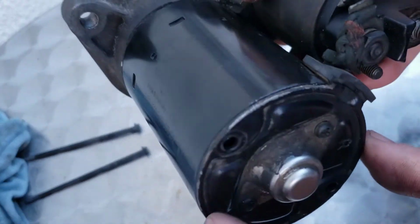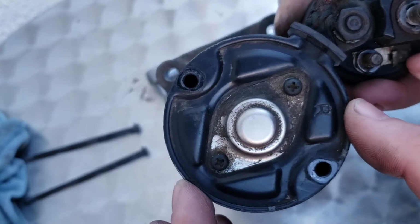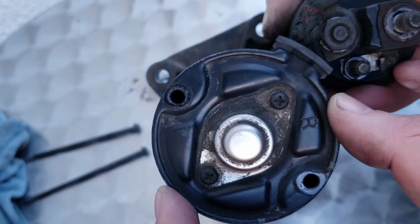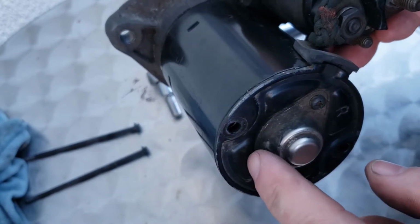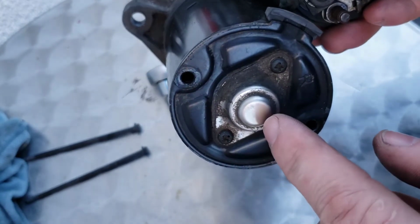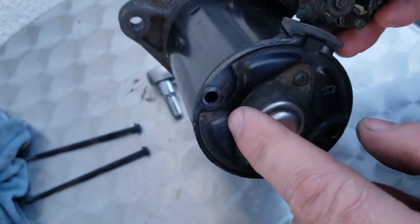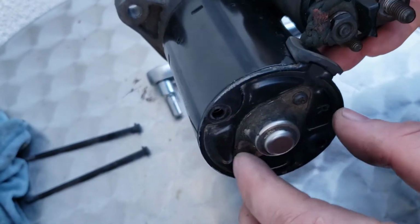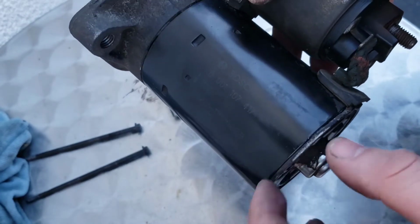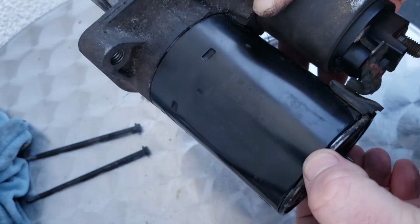You can get them off eBay, or somewhere like that. You can get them for like £15, something like that. Sometimes it is just the brushes. You can tell it is the brushes when you get the brushes out, which I'll be showing you in a minute. And you can save a lot of money doing it that way as well.